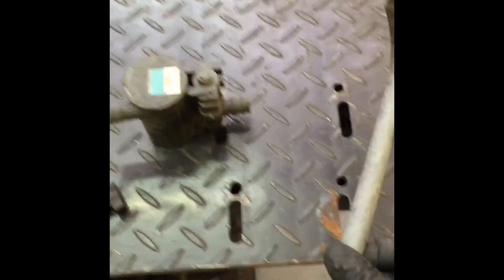This is what you want to see once you've got it all off — it's got that hose assembly. Now we'll go to the bench. This hose here we have to reuse; the new one does not come with this hose, but it's kind of melted or crimped on there. So I just took my hacksaw and sawed it right out. You want to have a nice clean area here too because we're going to be putting a hose on there to make it up to the new valve.